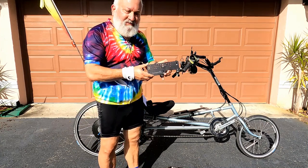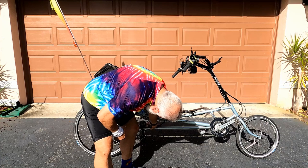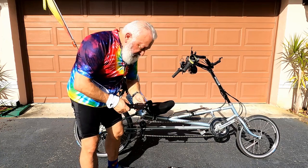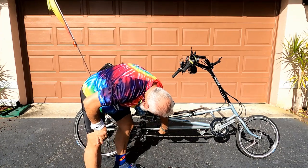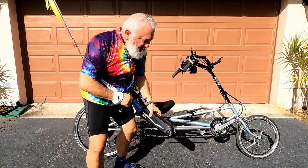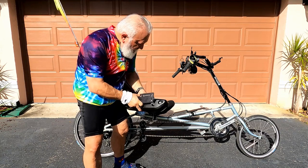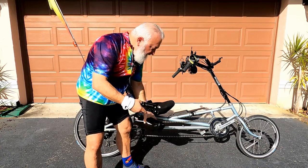So anyway, this is a twin tube mount, and you'll notice a little notch here, it's made to go here. But obviously, I can't put it there because I don't have enough room for the battery there. But if I were creative, I could take this and mount it upside down on the bottom here. But the downside of that, which I'm not happy about, is if I did that, I'm going to mount the battery upside down and water could collect in here. And I'm not happy with that idea too. But if you can imagine, if this battery were all the way down there, that's an even lower center of gravity. So I may try this as well.